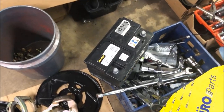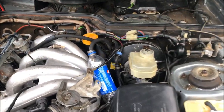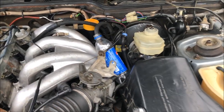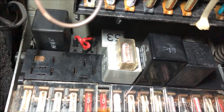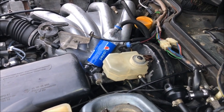I've got a good fully charged battery sitting here — I'm going to get this in and hopefully we can flush the fuel system out. Battery's connected now, so next I'm going to pump some fuel through this hose and make sure there isn't any crud left in it. Normally I like to use a gas can to do this but this hose is so short that it just isn't possible. I've got the jumper installed now and I checked the fuse — there was a little bit of corrosion on it but I've cleaned that off. The owner mentioned he wasn't hearing the fuel pump run when he was trying to turn it over, so the next thing I'll do is go back there and make sure we've got power at the pump.